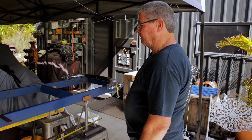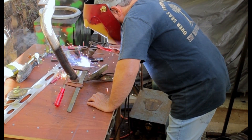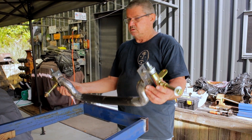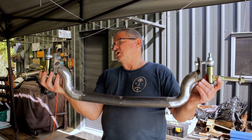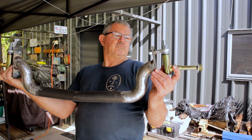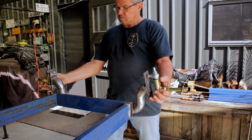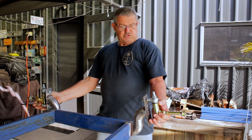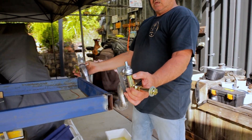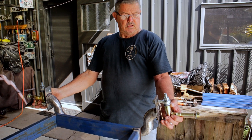During the week I also manufactured the front axle — it's not 100% finished but we're damn close. I've set it up the same way I set up my racing car with adjustable camber and caster on the front kingpins. That front axle will sit approximately in front of the chassis. It looks very similar to an old A-Model Ford, and I'll run a transverse spring across there as well, which is the suspension.